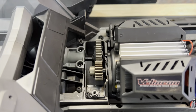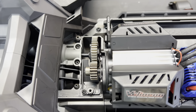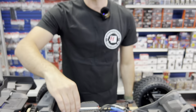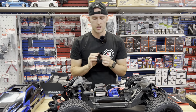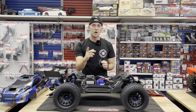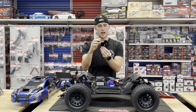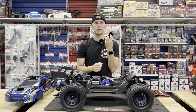Check this out. Stock out of the box, on the motor shaft there is a spacer. This spacer does two things: the first is it helps take away the guesswork of where to position your pinion gear so it's in line with the spur gear. The other thing it does is keep the gear in the perfect position to rest against this bearing. If you remove that sleeve and put an aftermarket pinion gear on — no problem with that — but you're going to have to guess whether or not this bearing is in the right position, and a lot of the time it's not. When you put the gear cover back on, it's either going to be pushing on the bearing at an angle, or the bearing is too far in and is no longer doing its job.